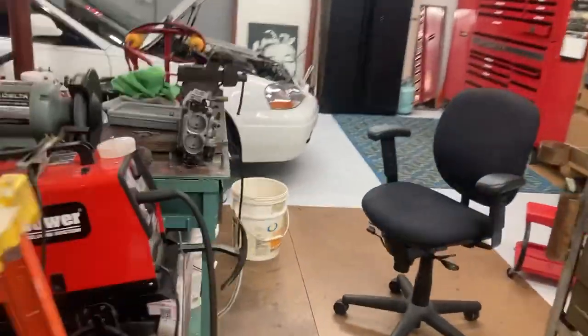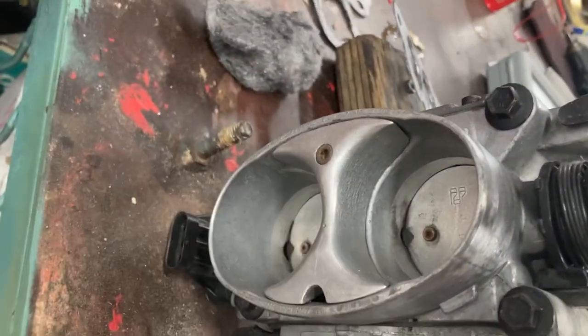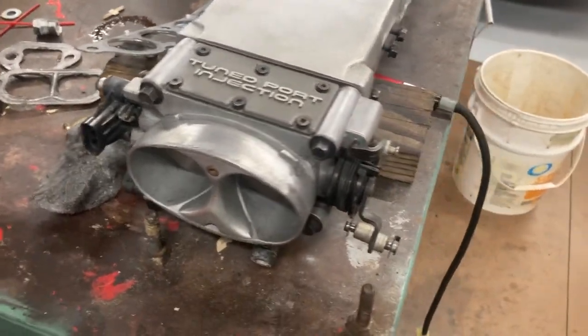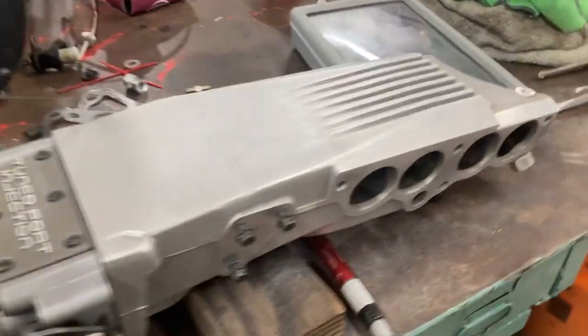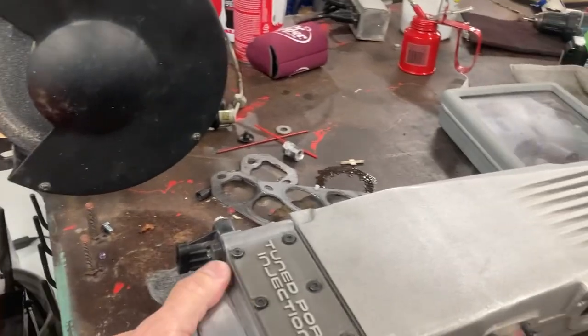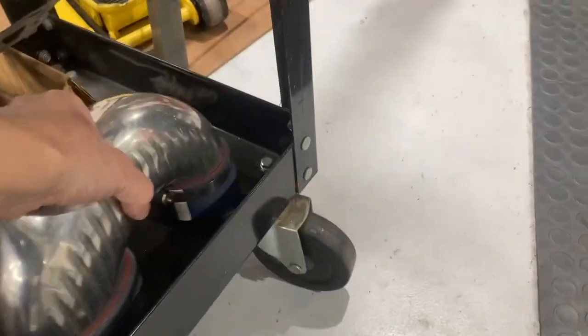I'm not interested in zinging the motor that high because I like to run it on torque, and it goes well that way. This is my throttle body — it's a bone stock one with the aftermarket piece in there. It's one of these dual 54s, and if you calculate the CFM on that, it's basically about the same as the Paxton. There's not really any reason to go with a much bigger throttle body on this. If you were running it normally aspirated, I would go with the dual 58 — it's going to help, give you more RPM, and flow matched with this system. But because the Paxton is going to force more air in, I can get away with the stock one. All of the Paxton pieces are matched up to this and they have to fit on there.